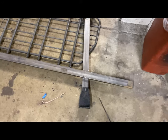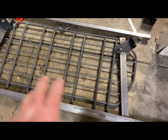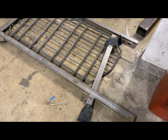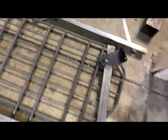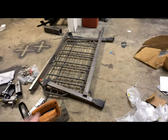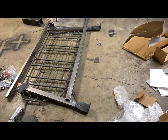I'm going to add a couple of cross beams in here — the thicker one goes at the bottom and the thinner one at the top — because I want to be able to mount some gear on here like a fire extinguisher and other bits and bobs so they're easy to get to. I also want to put my fridge back there. I'm going to chop off the excess on each side, cut the tube pieces, weld it on, clean it up, and get it painted up in the paint booth.